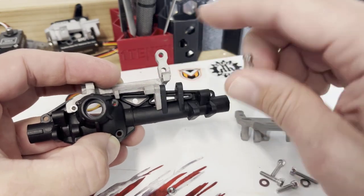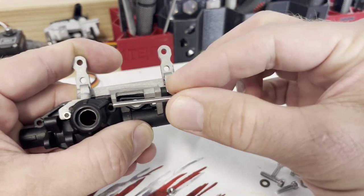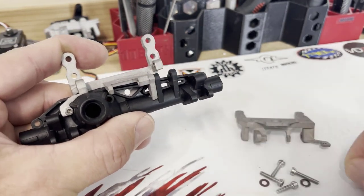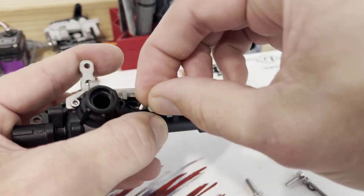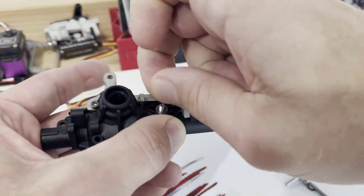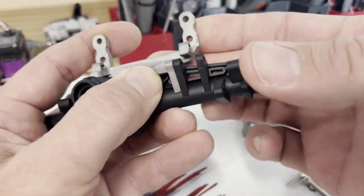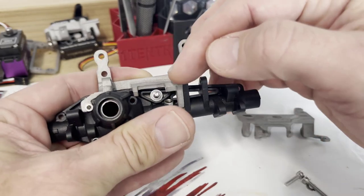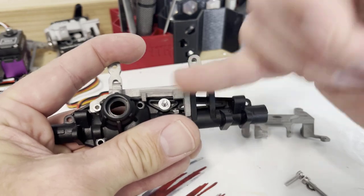You've got a couple of other options for securing at the factory link mount, and what you do kind of depends on where you're going to put your links. If you're going to center triangulate, you'll want to snip this off and run the M3 by 30 through here, then back it with a nut on this side — which is included. You get a bunch of those; you'll want to use Loctite. You also want to run screws through the truss — 14 millimeter works fine there. Slap a little washer on it to keep it outside the hole in the truss, then back it with a nut and tighten it all down.